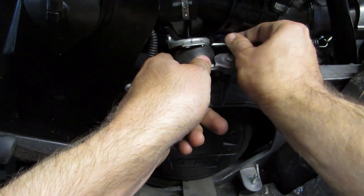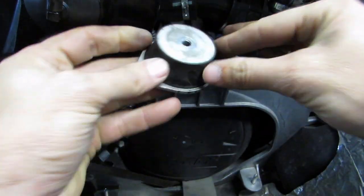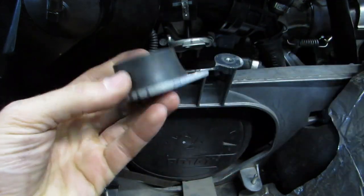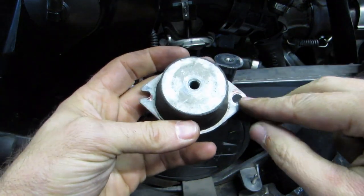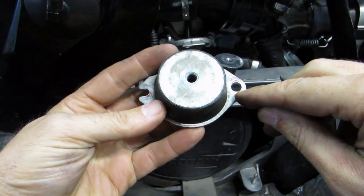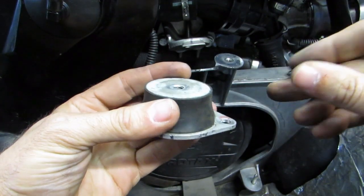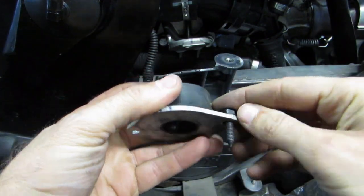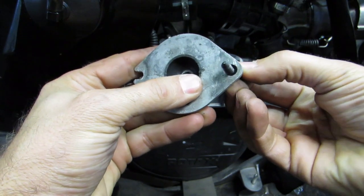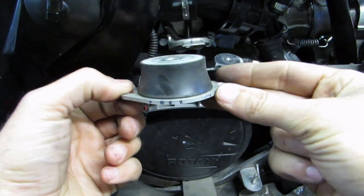This one has one of our shims in there - take that out. Then you can slide the whole motor mount right out. This one has a hole on one side and a slot. I've already drilled this hole out to 5/16ths, and what that does is allow you to have a little bit of movement so you can shift the mount.